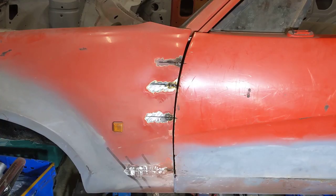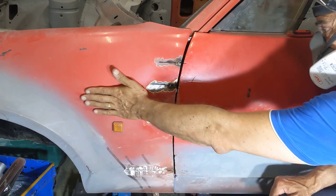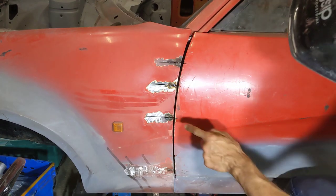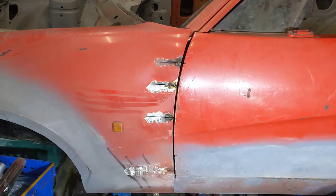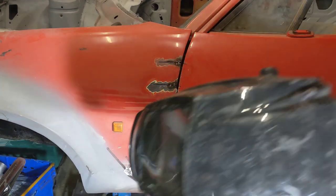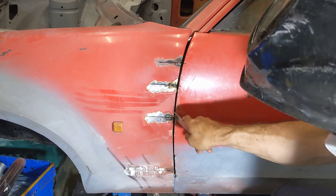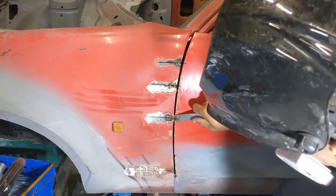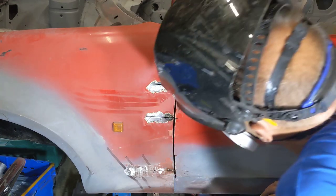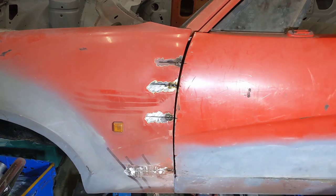We've got four cuts in there now - one here, here, here, here - and cutting these I did go into the door slightly so it's curving a bit, but I don't particularly notice it. I've done tack welds along here just at the end, but with those tack welds one has shrunk back in, so it was better before. I'll have to pull it out - I'm going to cut that one again, blend it down, then try welding it back. It's almost there, just here that it's still catching, so we'll cut that and have another go.